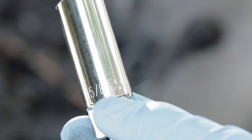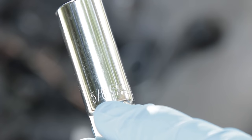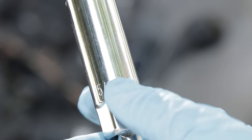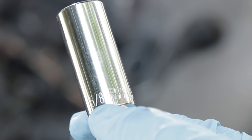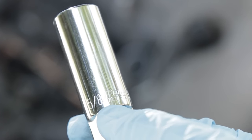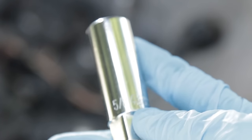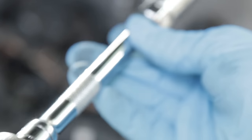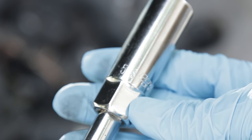The spark plugs I'm installing are technically 16 millimeters, but you're going to have a hard time finding a designated spark plug socket with 16 millimeters printed on it. Most of them say 5/8 of an inch, at least here in the U.S., and it's approximately the same size — you're going to be able to fit that in there perfectly without stripping them. So with that and your 12-inch extension, let's go ahead and remove the old plug.